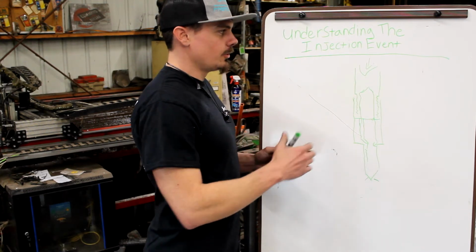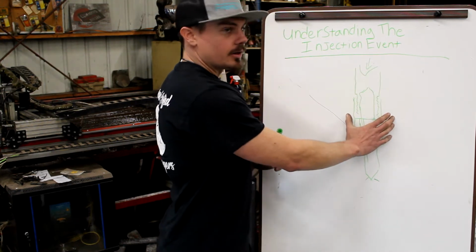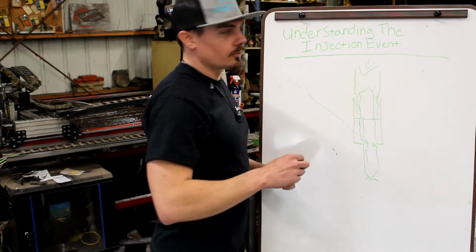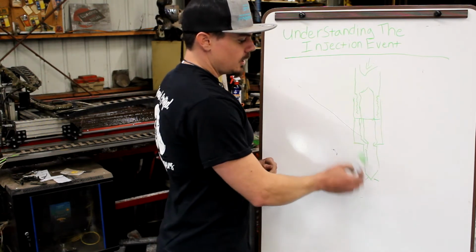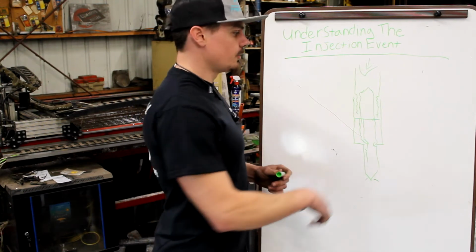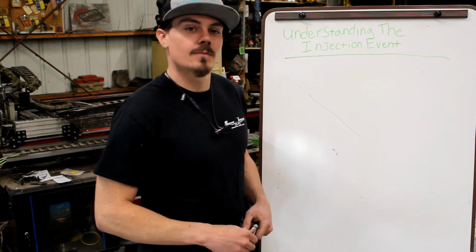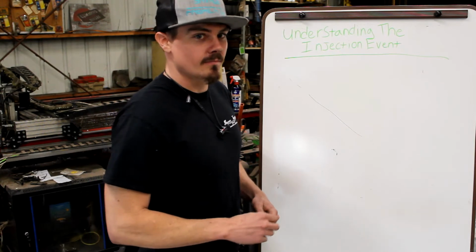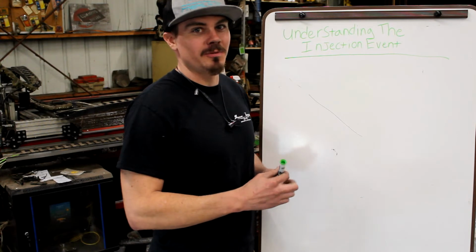Sometimes you'll see people post a photo of a body with the top off of it, and it's the lower body half that you'll be looking at that has these holes around the outside of it. Some of those are lubrication feed holes, and the other one is a feed hole to the nozzle itself. So when they talk about dual feed, triple feed, that means your injector builder took your body and put more feed holes in it. So you put a big injector in, now you don't have enough pressure. You know what happens with that? Yeah. Peak horsepower goes down.